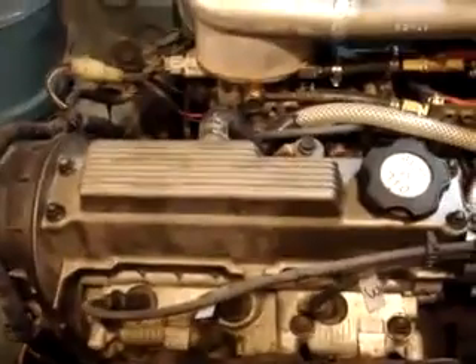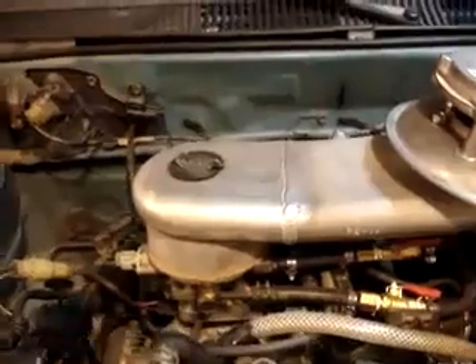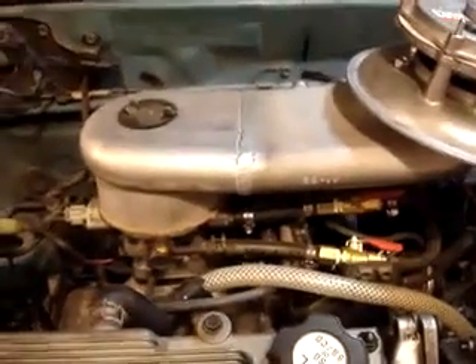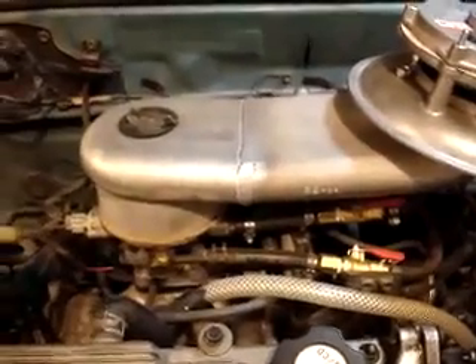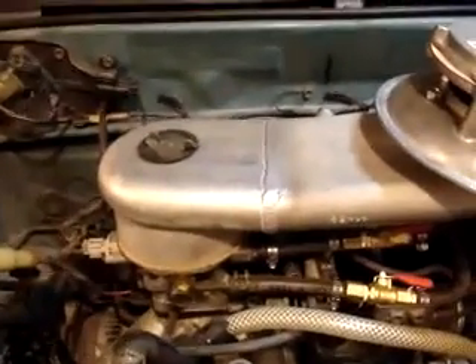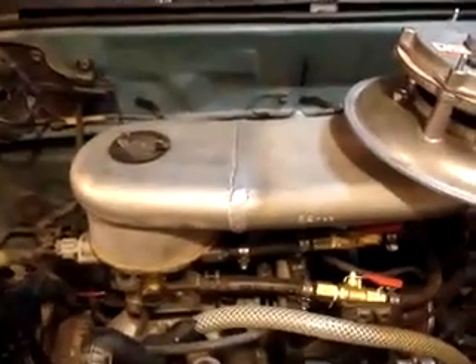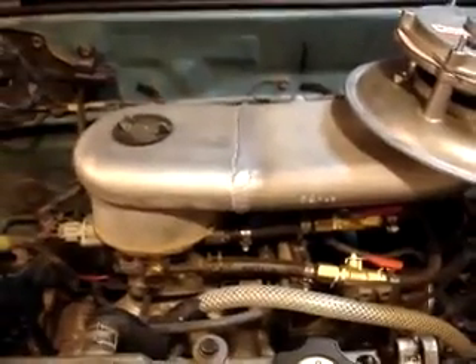This is a GeoMetro — a three-cylinder, one-liter engine, carbureted, and it has a 55-amp alternator. When I ran this on HHO, I used an alternator off of a much larger car and jumped it over to this battery so it could keep up. We could idle this car easily at five liters a minute, and of course if you step on the gas it would take more hydrogen — up to 10, maybe 15 liters per minute, depending on how hard you got on it.